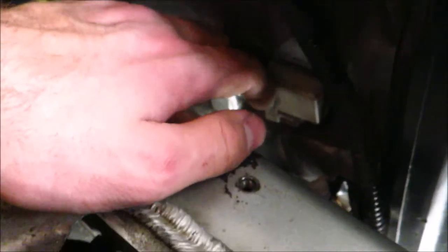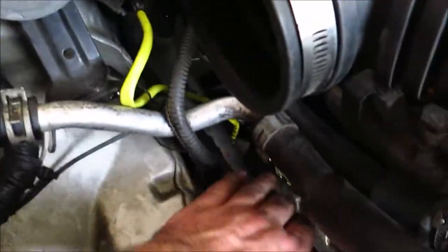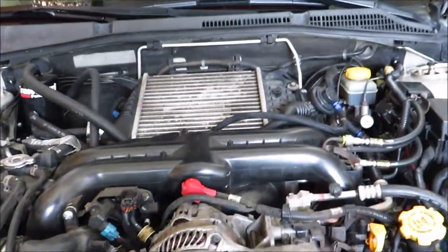This side is really warm. You just pull on the bolt, twist it 180, and pop it out — there's cylinder 1. And now you've got to pull this one out — ow, my hand is hot. This one you kind of have to rotate and pull toward the front of the engine, and it's out. Now we've got all the coils out — probably ten minutes if you count the time I was filming, maybe less.